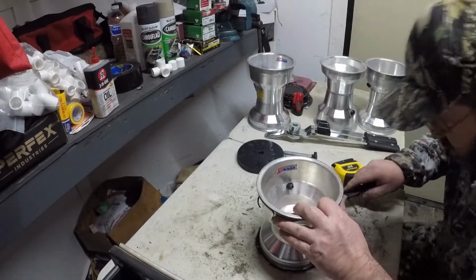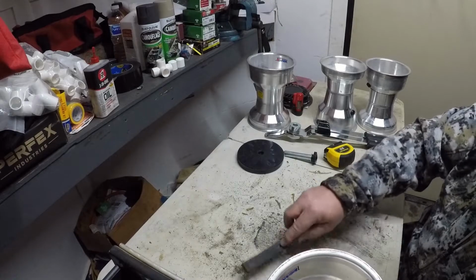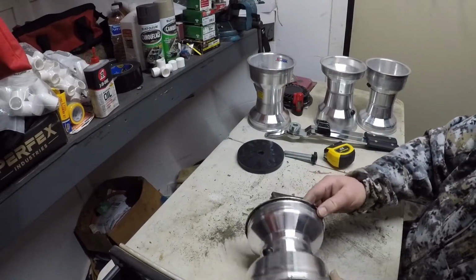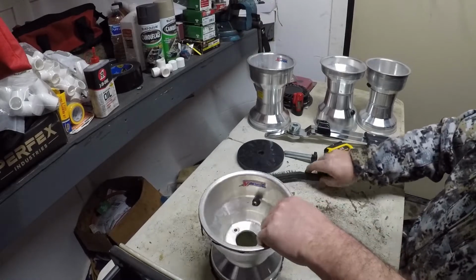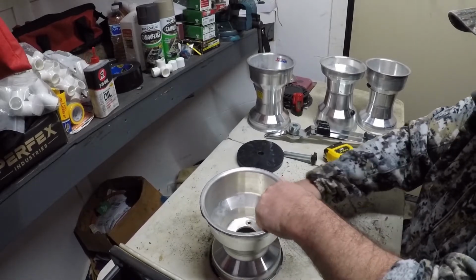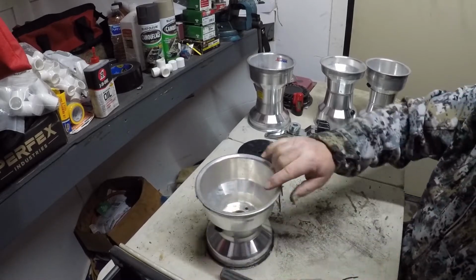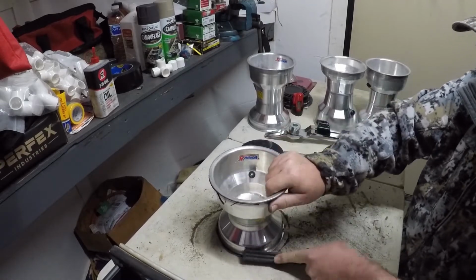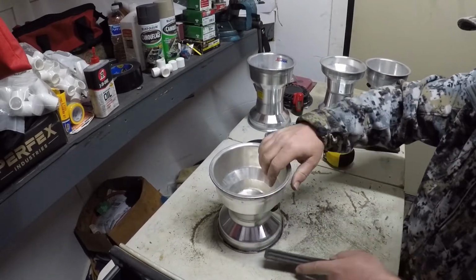Alright, now when you break a wheel down, take a tire off of the wheel and you're going to reuse the wheel, you want to clean the beads. And, I always go over the beads with a wire brush. Like this right here. Here, let me do it on this side so it's pretty straightforward. You want to always clean these beads off.